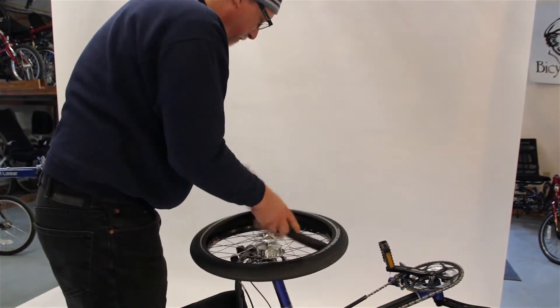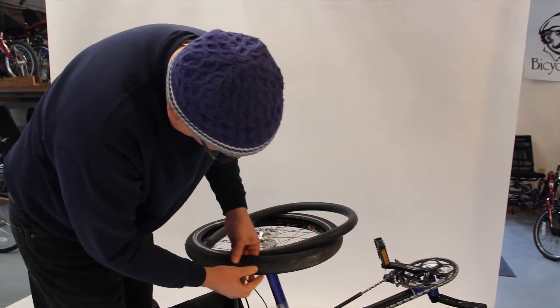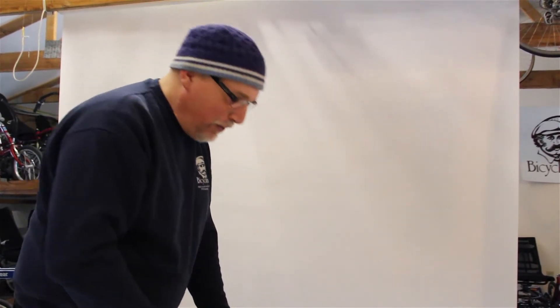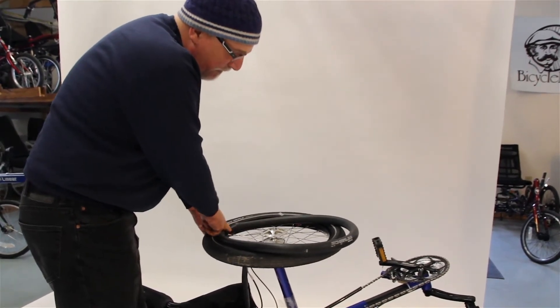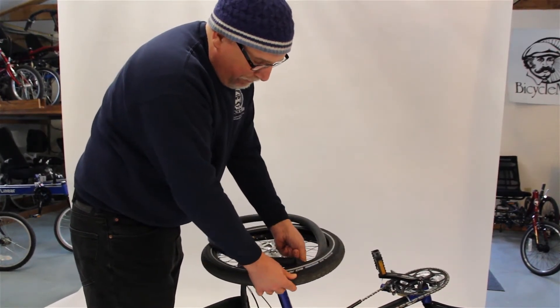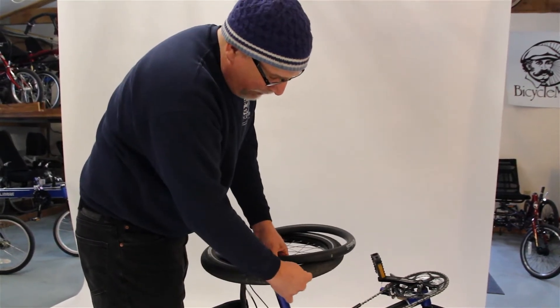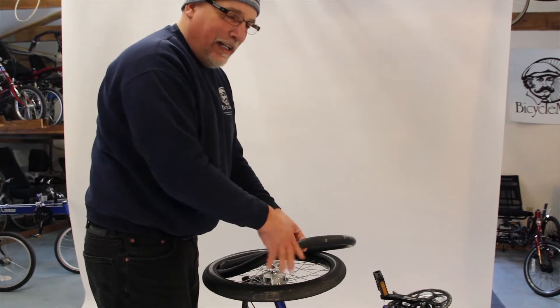Now I'm going to take the tube out and look at the tire to see if I can see something obvious poking in it — something sharp, something pointy, a little piece of rock. Or maybe I banged a curb a little while ago. One thing that's nice is if you leave the stem of the tube in — because we always put the writing right where the stem goes through the rim — you can get an idea of where the hole is in the tube. Like say right here we found a little rock, then I could go back and know the hole in the tube is somewhere around in here if I wanted to patch it.